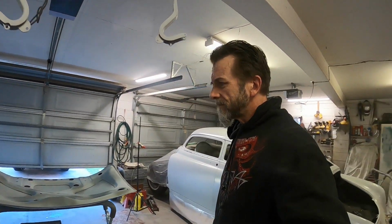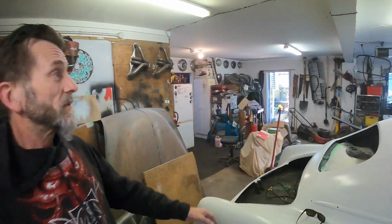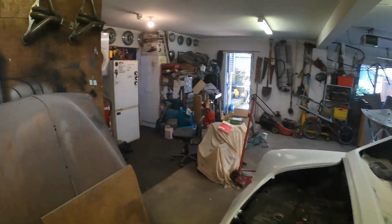Yeah, still spray gun problems. I didn't filter my primer, so a bit of shit came through it in the paint. It could have been in there. It shouldn't have been in the spray gun because that all got cleaned out real goodish. But yeah, spot primed. Sorry, camera's pointing all over the place. I'll let that set up a bit, and then I'll give that a little whiz over with the Scotch-Brite, take the fuzziness off, and then we should be good to go, maybe. Can't forget to paint the hinges up there too.